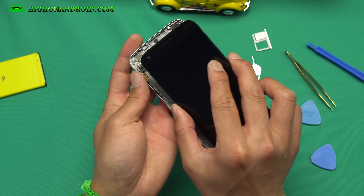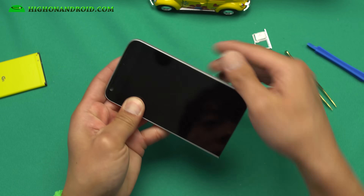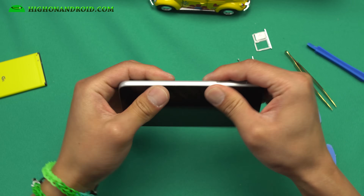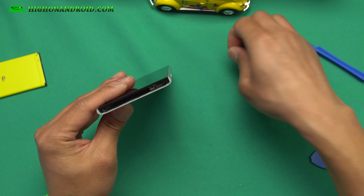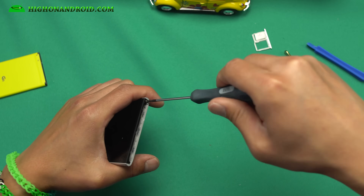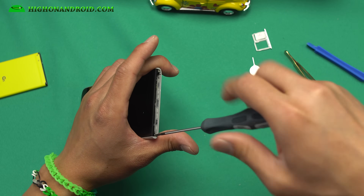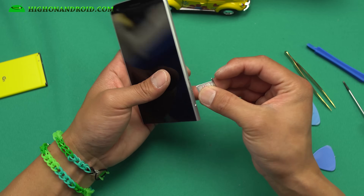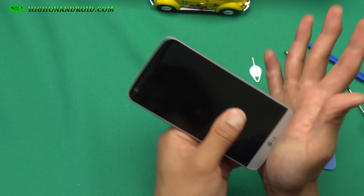When you put it back in, start with the left side like this. Lay it down, and just sort of hold down the side here so it won't go up. Sort of push slowly until it pops in there. You hear that pop sound up on the top — pop sound. And that's it — you've got two screws here. Knowing that this phone is so easy to fix makes me more comfortable just banging it everywhere, but I would still use a case. It still costs money to replace screens. Once that's done, go ahead and put your SIM card back in and put your battery back in or whatever module you're using. Snap it in there.